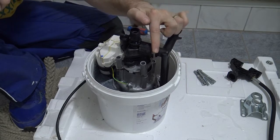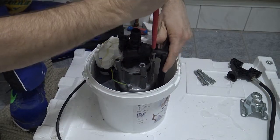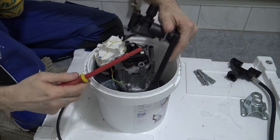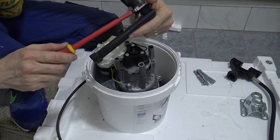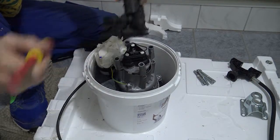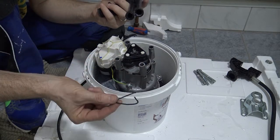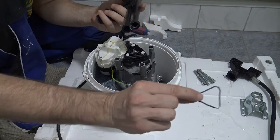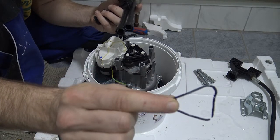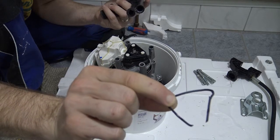I'll show you taking off this clip. Again, you could loosen the sides with a screwdriver. Oh, okay, it's already off anyway. I guess I don't have to loosen anything. I'll leave it intact. Here is my failure from last week. It's a broken gasket. And it's broken because I squeezed it down before it was set in place properly.